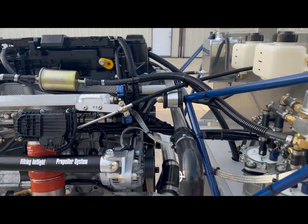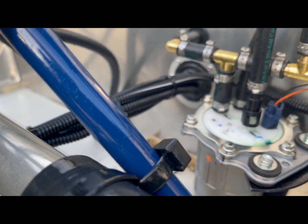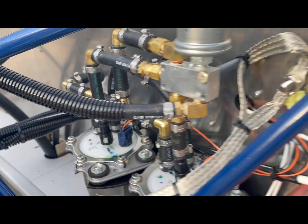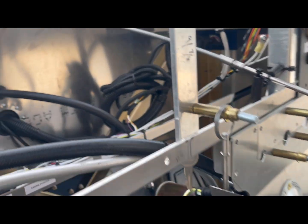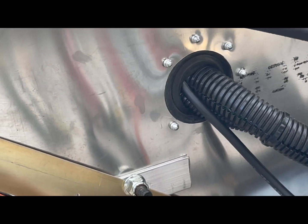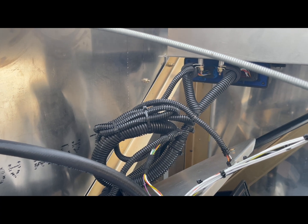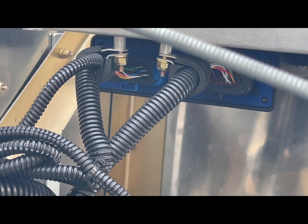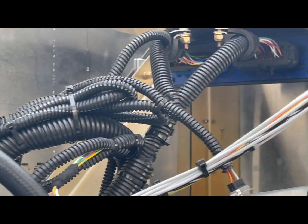Inside this airplane we ran the wiring — the computer wires — all together into a firewall passthrough. We'll go take a look on the inside and see what that looks like. The passthrough comes in there, then we bundled up the excess cable, mounted the ECU to the bottom of the glove box, and strain-relieved the cables.